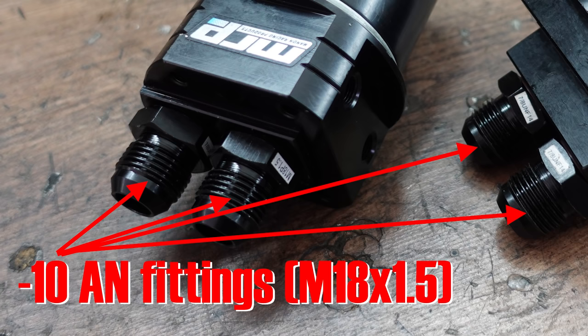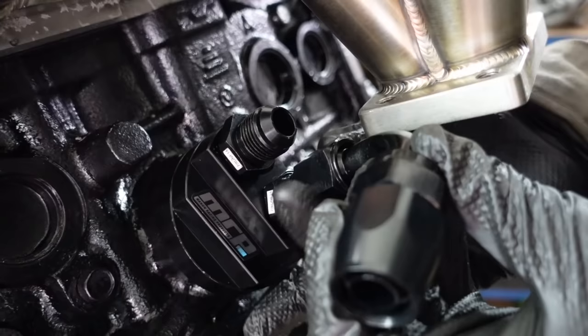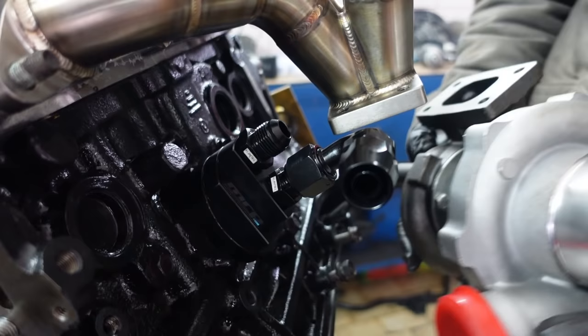It's designed to fit Dash 10AN or Army Navy fittings for a leak-free, easily removable and serviceable connection. Dash 10AN is a large cross-section fitting which ensures optimum flow and it is the recommended size for most applications. However, there is a problem with this kit. As you can see, the fittings point outward at a right angle from the engine block wall and the AN fittings add to the profile of the adapter, which again results in potential clearance problems.